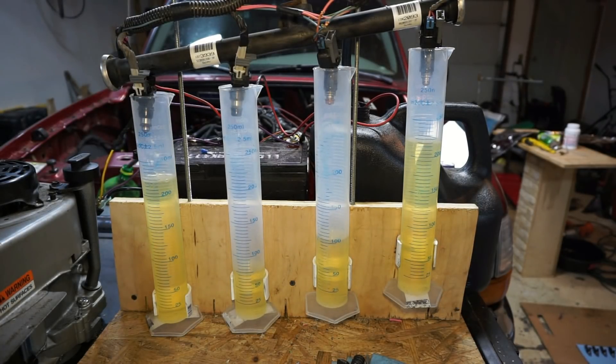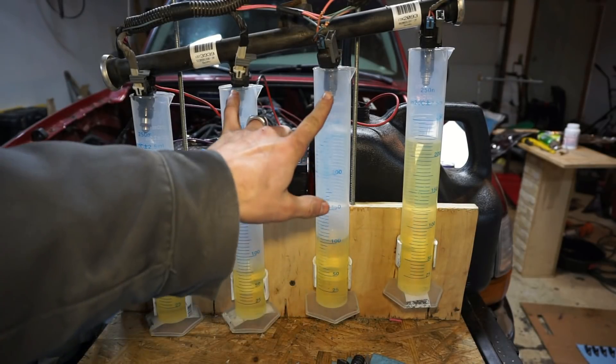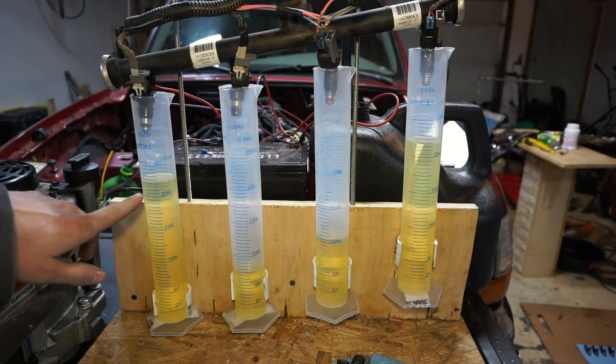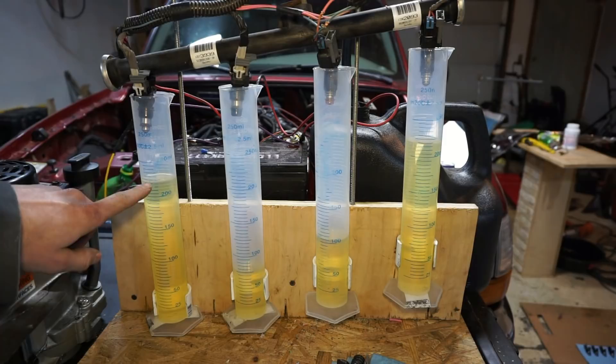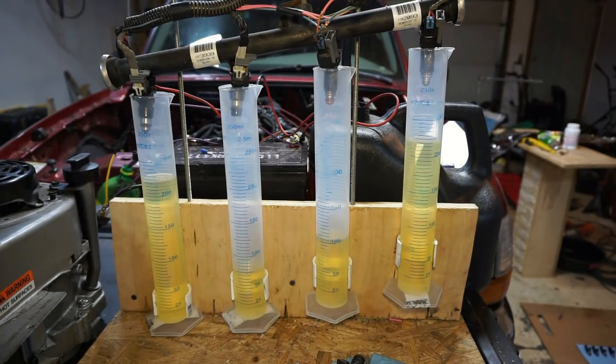All right, that ran for a while. The capped regular injector is at 105 — it was 100 last time — so again about 25 percent more with the capped flex fuel flowing more, which makes sense if you're gonna be using ethanol and need more fuel. The decapped readings came in at about 222 and then about the same on the flex fuel. I think that flex fuel injector is still kind of gummed up though, so I'm gonna do another test with a different one — I don't really trust it since it was stuck and actually leaking for a while.